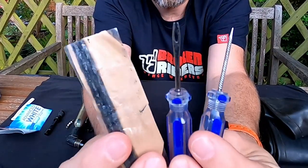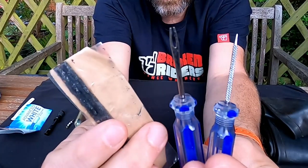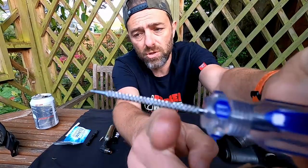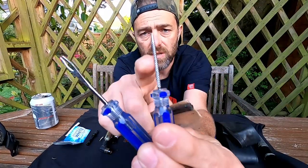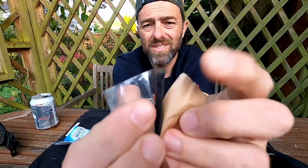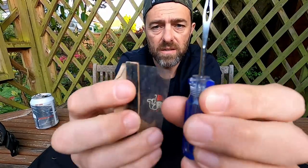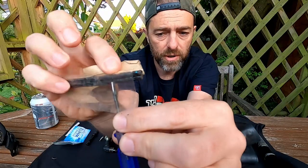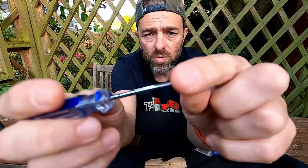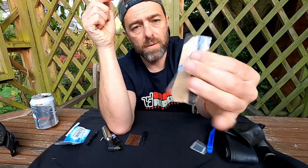These devices here come in a kit from a company called Weld-Tight — I'll put a link below. If you get a hole in your tubeless tyre that your sealant's not quite sealing, this is the stuff you use to repair it. You've got a rough edge on here for making the hole a little bit wider and roughing it up to allow these sticky plugs to stick. Then this tool here is for inserting them — you take one, thread it into this slot, poke it into the hole, pull the tool back out, and that leaves the plug in a V-shape to seal the hole. You can then trim them off however you want.